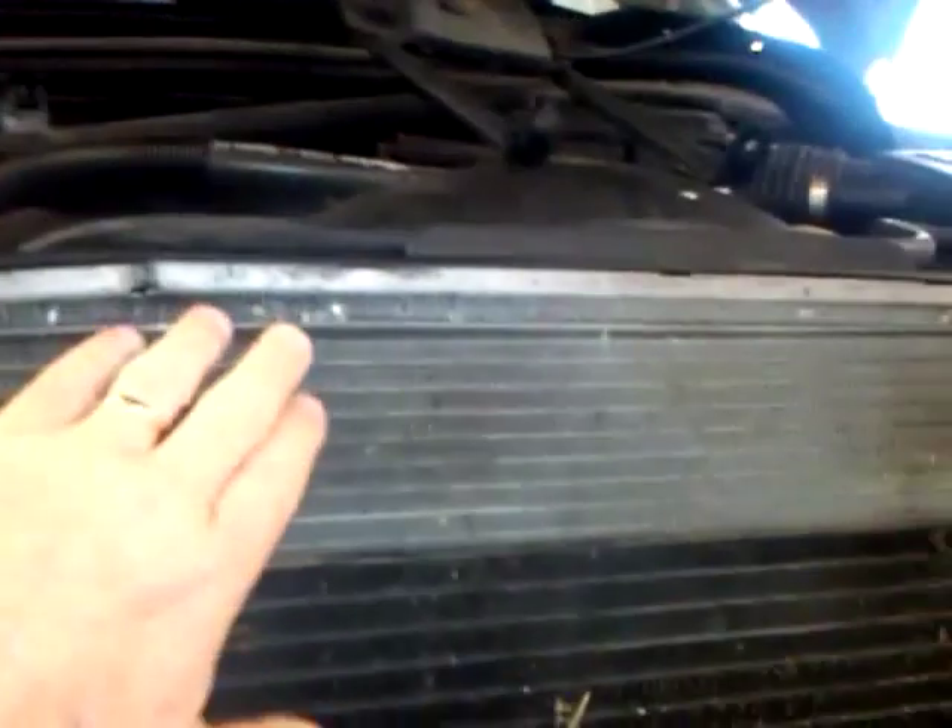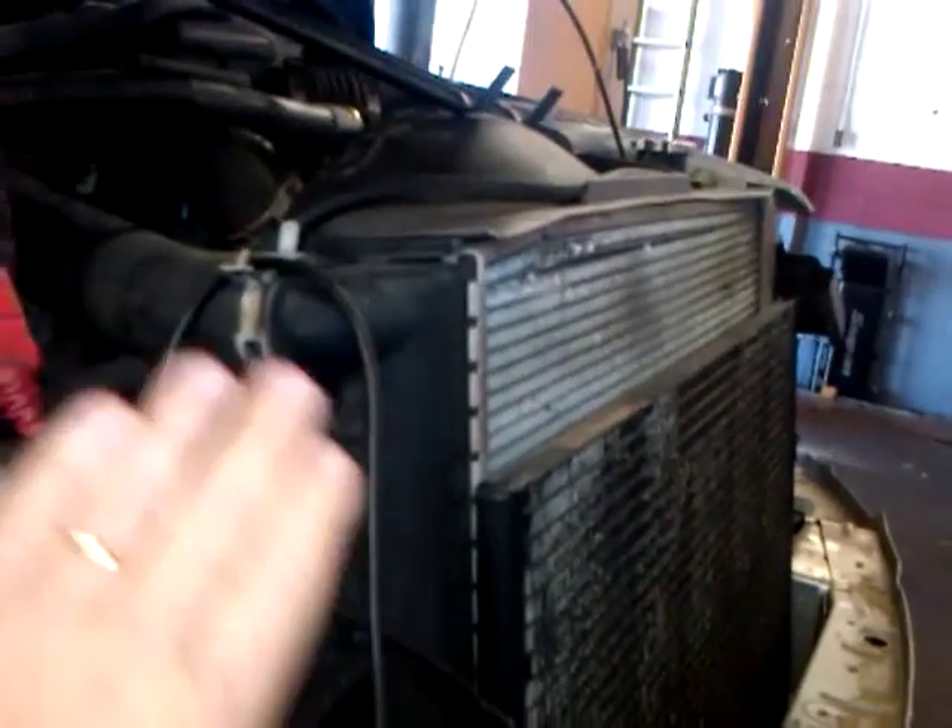First and foremost, we're looking into this area here behind the front bumper cover and into this tiny little relay down here that actually operates the fan. But more so, we can see damage along the area that was hidden by this strike. You can see where the radiator has been raised and it's actually pushed back a little bit, so there's a compromise in this area, and of course the normal wear and tear of an air conditioning condenser. You can see it's raised and it's not square and level, and it's hard to tell here, but we're kind of pushed back a little bit.